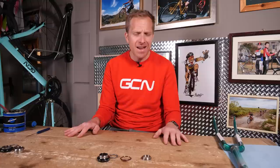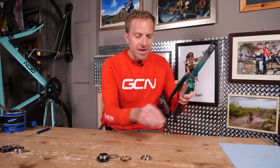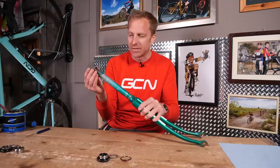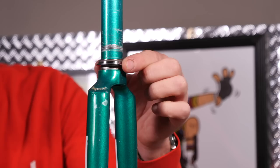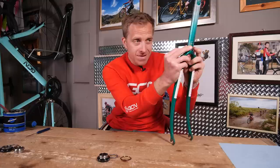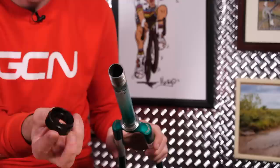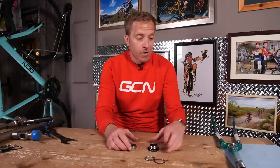Let's actually assemble the headset on a real bike. These forks are from an old bike of mine from at least 20 years ago. First up, we're going to start with the fork crown race. This is interference fitted onto the bike — steel is a wonderful material, quite resistant to abuse. You've got the angled piece at the uppermost part, because that's where the bearing is going to sit. I can't quite get it all the way on by hand, so I need to hit it into place with the crown race installation tool.